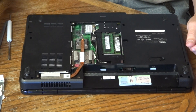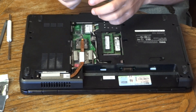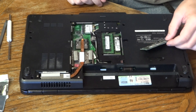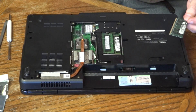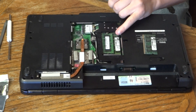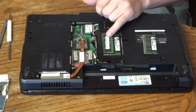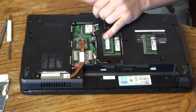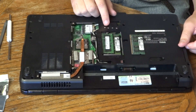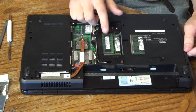So the reason I only got one RAM stick — it's a 2GB Kingston chip — is because for some reason when Dell built this laptop, or if somebody changed it before, I don't know, I got this used. There's one Kingston 2GB chip in here and a Samsung 1GB chip for a total of 3GB. But I always like to have matched pairs, so I picked up another Kingston 2GB chip to replace this Samsung 1GB.